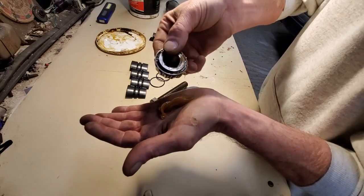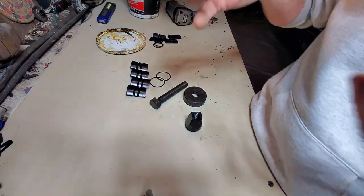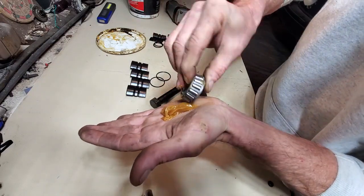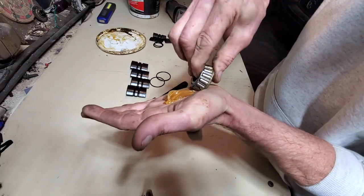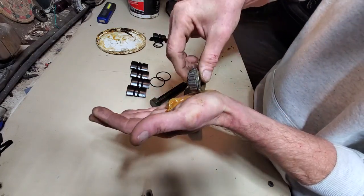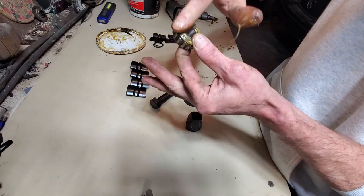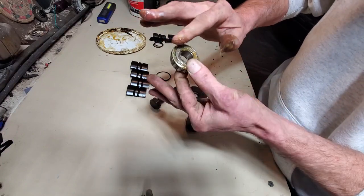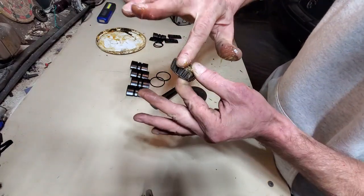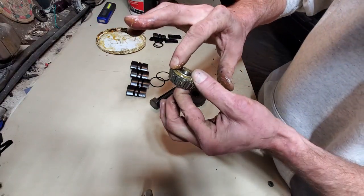When you pack bearings, you want to scrape it up into the crevice. Turn this light on here. Dang it. That might help a little bit. You got that empty crevasse. You want to scrape it in like that. They make a tool to pack these. Every time I break it out, I end up using excess grease. Some people who work around bearings a lot can just guess how much grease they need to pull out and put in the palm of their hand. But you're supposed to be massaging it into the backside up through here, and it traces right up through the channels and starts appearing at the top. That's when you know you can stop.